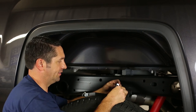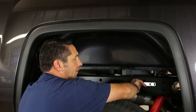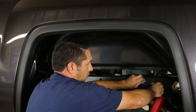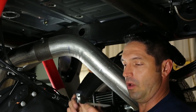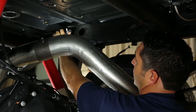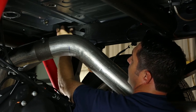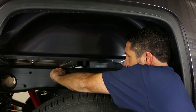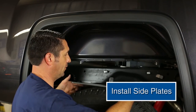Now we're going to install the bolt guides. The short ones are the easiest — simply put them inside the large slotted hole in the frame and rotate the bolt into position, pull it in flat, and repeat on the driver's side. For the long bolt guides, install them from inside the vehicle frame using the large hole in the frame that's right above the bump stop — insert your bolt and strap, then pull this up to get the bolt into the best position from the outside of the vehicle.